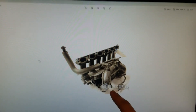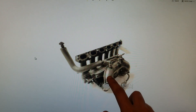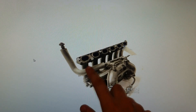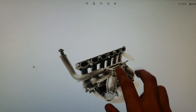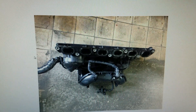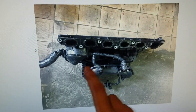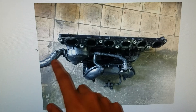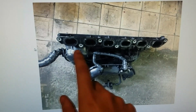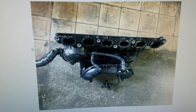Let me show you some pictures of what these different setups look like on the manifolds. First setup: this is a 328i — hose and everything going into a three-stage manifold. You can see the stock 328i hose just plugs right into the two ports. Next: this is for a 325i dual-port — the hose comes from the valve cover or separator/PCV and goes into the two ports.